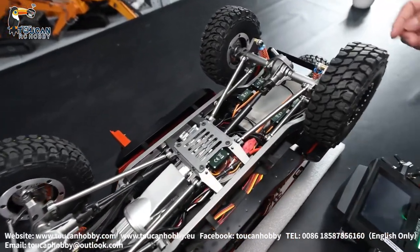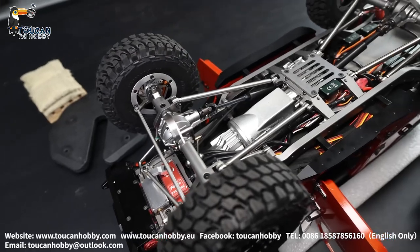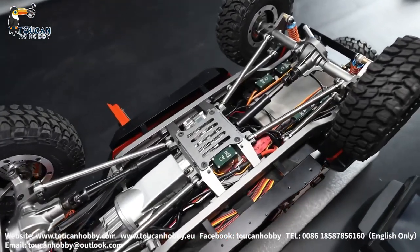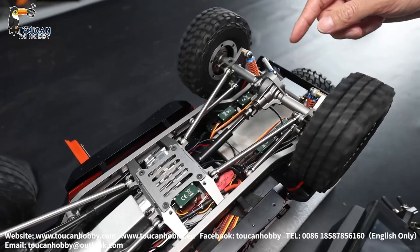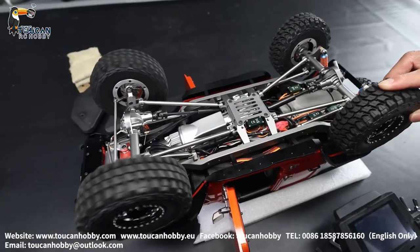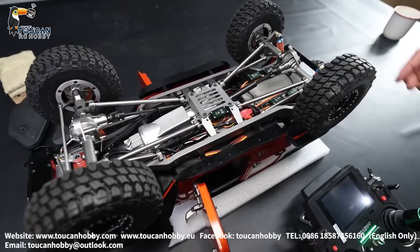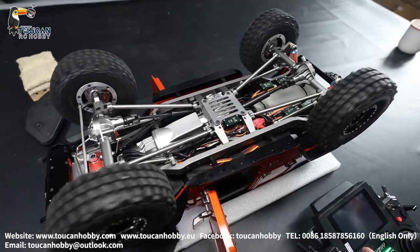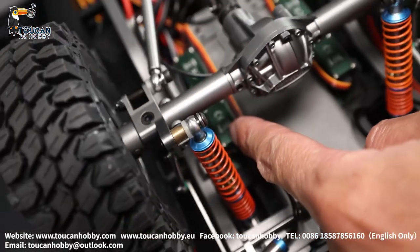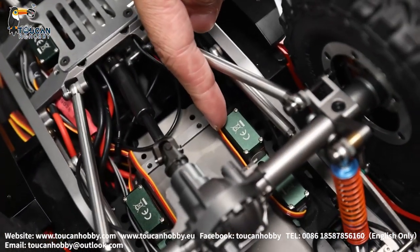Lock it — differential lock. Now it's for driving. Now it's rear driving. Now it is front driving — rear side still has power from the gear resistance. If you hold it, it will stop. Only the front has full power; the rear side only has a little power from gear resistance. Changing back to four drive. This servo is for differential lock. This rear-side servo is for high speed gear. This servo is for low speed gear.